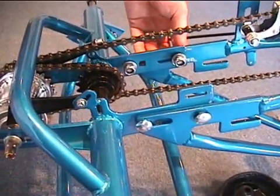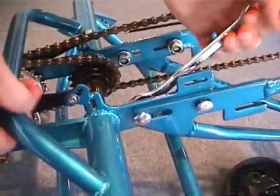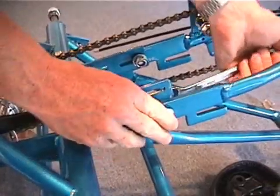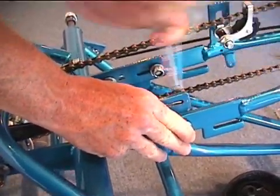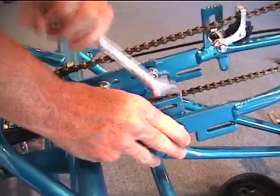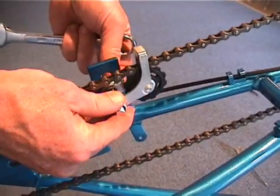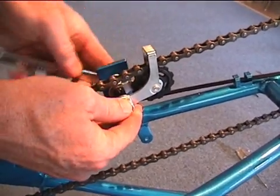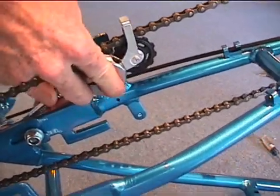Next, we secure the rear end of the frame, taking all the slack out of the chain using a 17mm or an adjustable wrench to tighten all 4 bolts. Then the pulley wheel will be used to take up the final amount of slack with one simple adjustment.